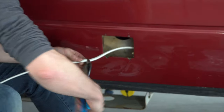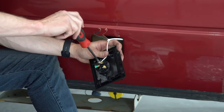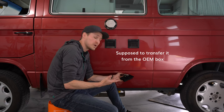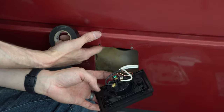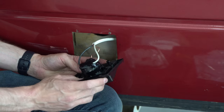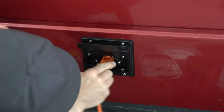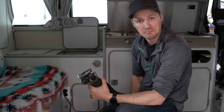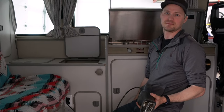So that's our old box. What we're going to do is disconnect the other side of this cord at the circuit breaker, cut ourselves some new wiring, and run it from the circuit breaker to the back of our new box. The instructions mention there's a plastic cover that goes on the back to cover the exposed terminals — we don't have that, so in case a tool or something metallic touches those terminals, we're going to cover it in a bunch of electrical tape. Now we have all three boxes with these nice new hinges. The battery charger seems to be working, which is a good sign since it's plugged into where the stock fridge used to be.